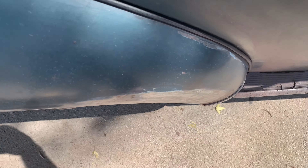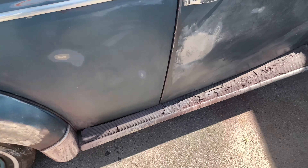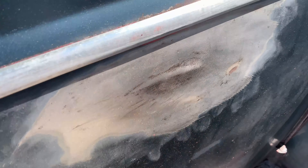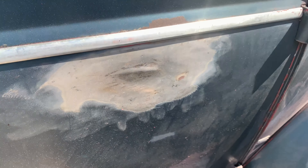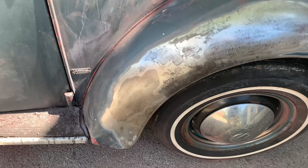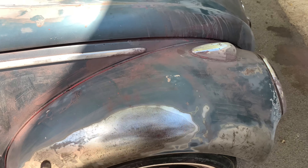You can see it's straight. I stripped out the rest of the filler — there was just a tiny little door ding, which is expected. This one's kind of odd — you can see how it crowns out and then dips. It's a weird dent, but should be able to metal finish that out and pretty much have that all gone.